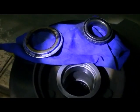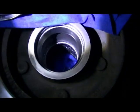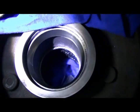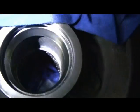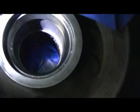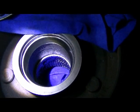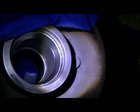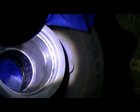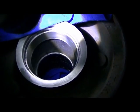Okay, I'm back. Got the seal out, got the bearing out, and we can look in the inner part there. Cleaned all the grease out. Just wanted to do an inspection. Went around it, make sure that there's no discoloration, no pitting where the bearing rests. I guess that's called the race. Could be wrong on that. Don't know. Backyard mechanic. I'm into electronics myself. But anyway, so just want to make sure, again, there's no discoloration anywhere, pitting, or anything that would look abnormal.